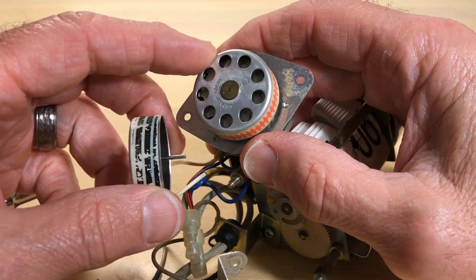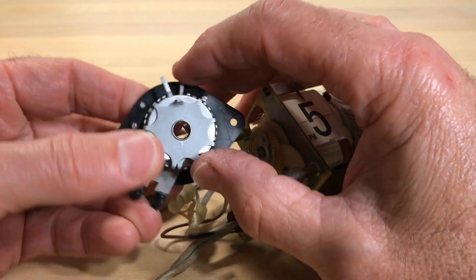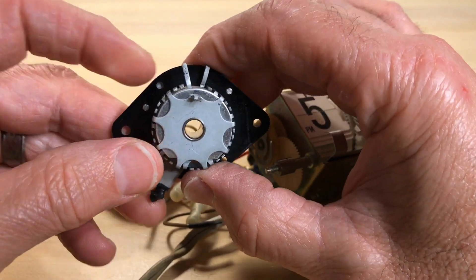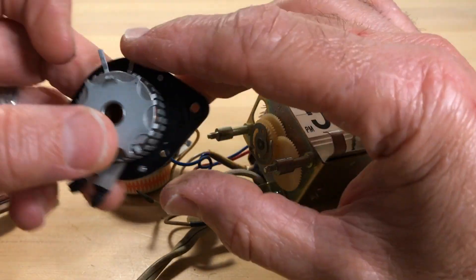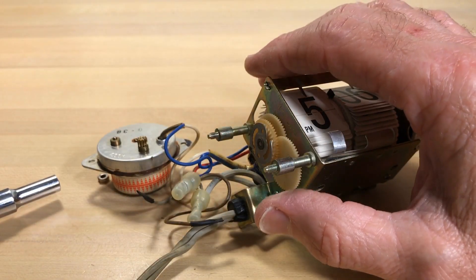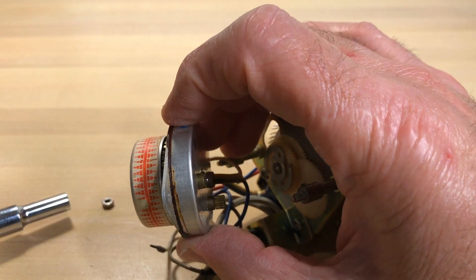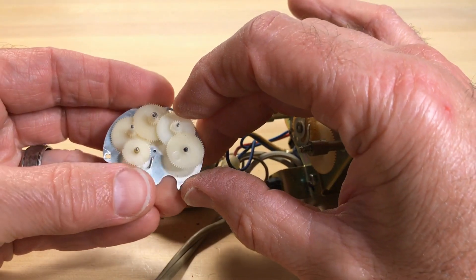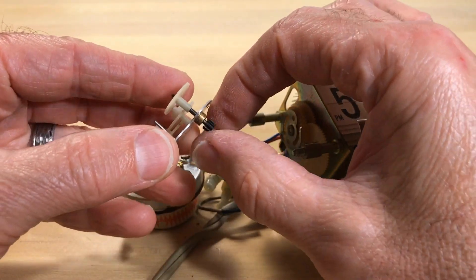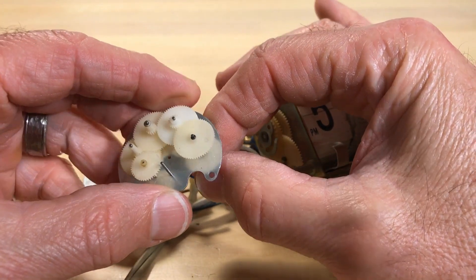All that stuff inside is part of a cage — this is one I've torn into, so this is the cage. I've pulled back some of these things so you can see the windings. None of that turns — nothing turns here. I've punched out the bushings; they go in here, so those are missing. That's for another video. Inside of the gear case there's something sort of like this from a different clock, where it takes the simple motion of the turn and gears it so it has enough force to actually move the clock.